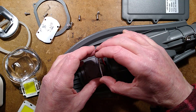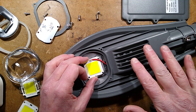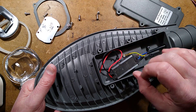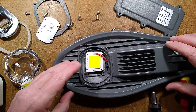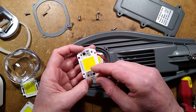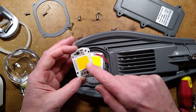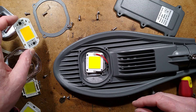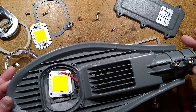You'd think they'd want to get rid of the driver, because with the electronic driver in here when it fails it's going to do that pulsing thing these types usually do. Whereas if they went with the driverless LED, when those fail they'll arc internally, burn up, and go open circuit. But there is a possibility with driverless LEDs that they can actually shunt onto the case, which could cause earth problems. So maybe there's a reason they've stayed with the electronic driver.